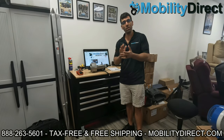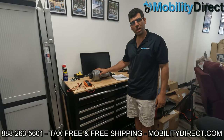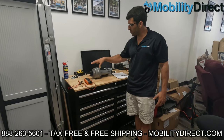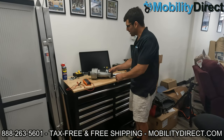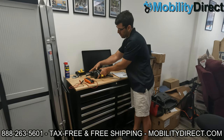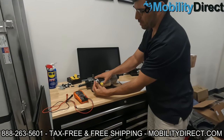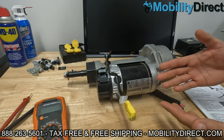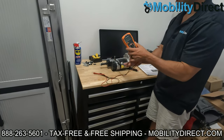Welcome back, and hopefully you've subscribed. Good luck to you if you did. Now let's get started. Most mobility scooters come with automatic brakes known as an electromagnetic brake assembly, and it's attached to the motor itself. This is a 24-volt transaxle motor. The electric brake assembly is here and it has a switch which you can use to turn off and on the automatic braking assembly. There's also a lead here with a connector that has two wires, and we're going to be testing these two leads to see what the resistance is using a multimeter.